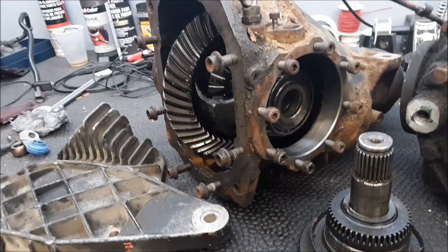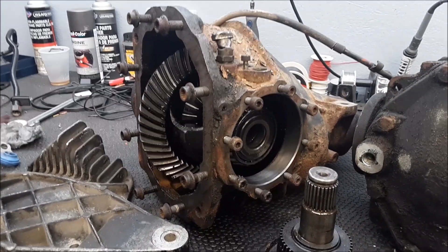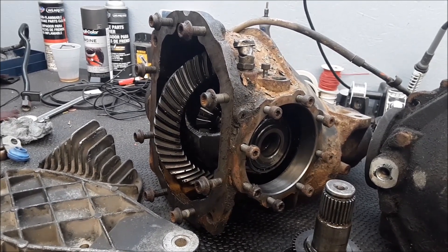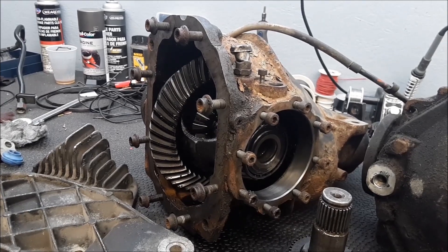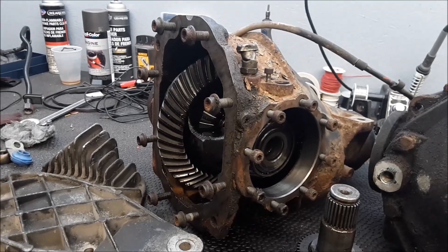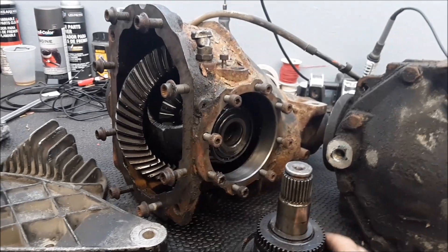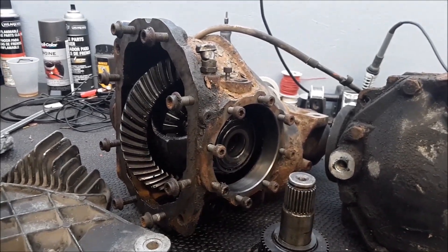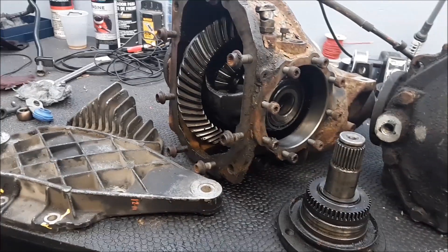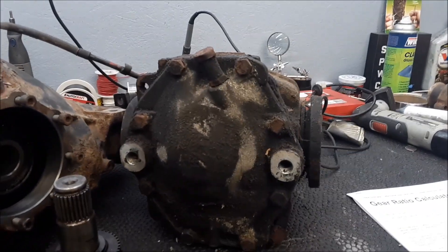So that car will have small axles. I'm thinking maybe if I break axles or have issues with these axles, I will probably attempt to find an early 140 body or an early 500SL that has the larger differential that's non-ASR. At that point I could probably swap out the stub axles. The only way for me to know at this point would be to buy a used differential — I'm just not willing to do that right now. So we'll see how these hold up. Maybe they hold up fine and I never have to mess with it.